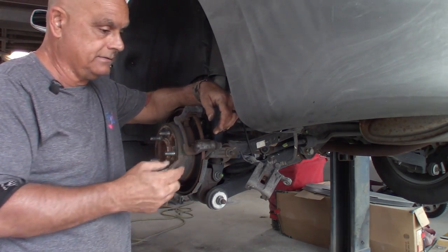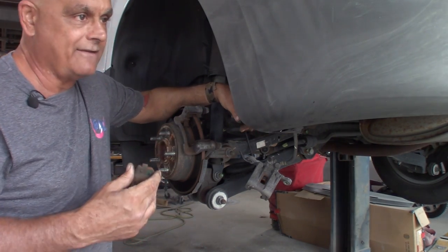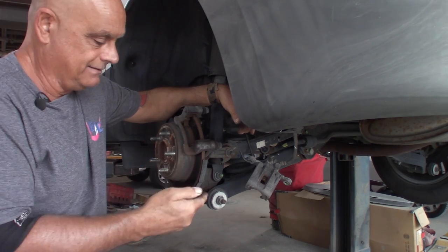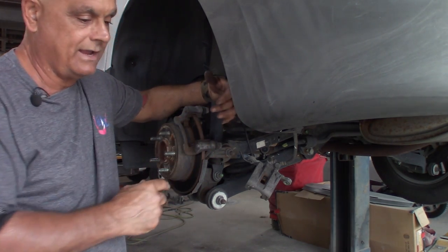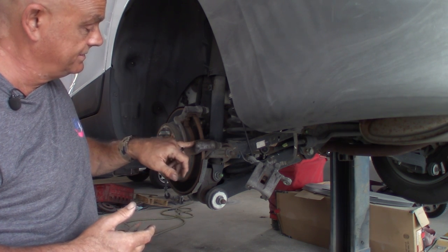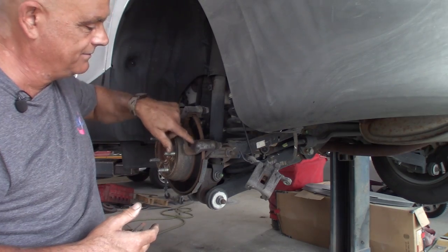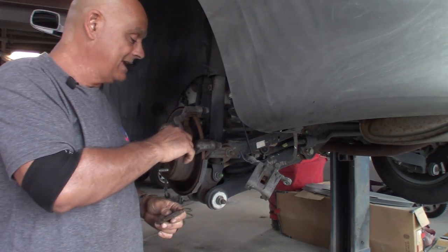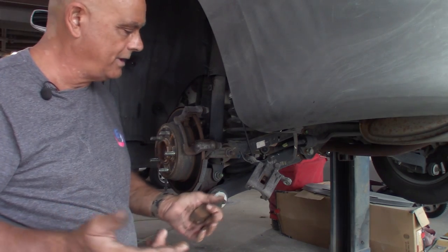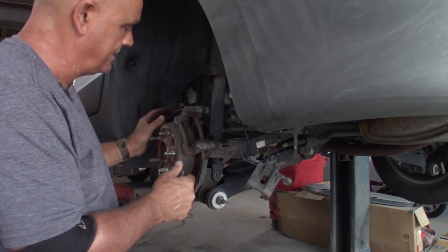Looking at the slides for the pads, I'd rather go back with factory ones to be honest. Especially on the slides — I've seen it many times where the aftermarket ones just don't fit. The pads don't sit right, they don't fit on the caliper bracket right, they're sometimes just junk. So if I get one that looks as good as this, I'll just clean these up and reuse them. If they're all rusted and pitted up, no, you've got to toss them. But in this case they look pretty good — we don't live in an area that gets a lot of snow, cold weather, and salt, so they usually last pretty good.